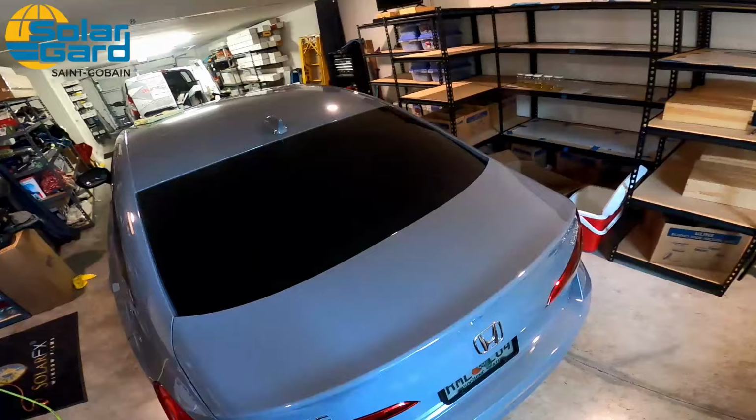Reasons why is because for the side windows, you don't really dry shrink, you wet shrink, and it's because the fingers are just a little bit smaller. But for a back window, pretty much the entire thing does need to be shrunk to be form fit. The problem with wet shrinking a back window is that you aggressively shrink certain portions of the film while other portions of the film do not get shrunk at all.